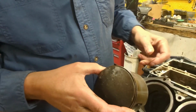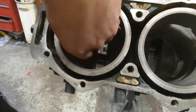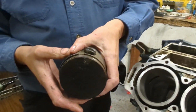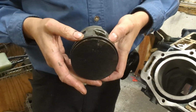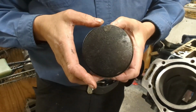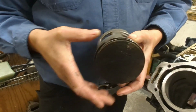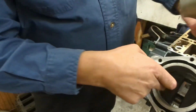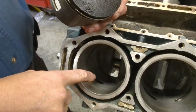So this goes up and down, and these ports line up and let the fuel get into the engine and let the exhaust get out. So if this ring had its separation point, and no rings are all in one piece, it's got a little spring to it, that's what makes compression. All pistons have rings on. If this ring was here, that end of that ring would catch this port when it went by this hole here. This one right here would catch that port and go.